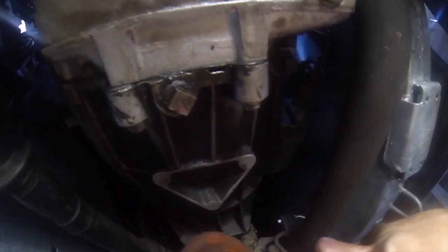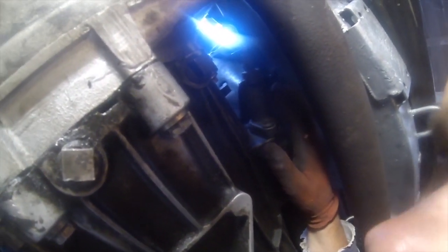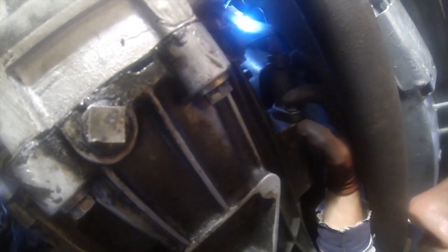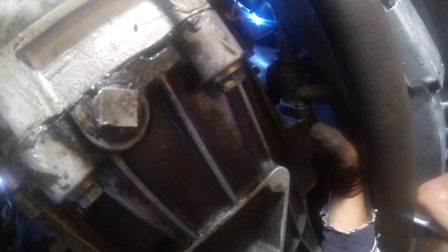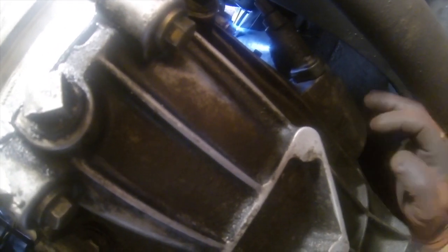Right, now under the vehicle, this obviously is the bell housing at the back of the engine, before the gearbox. Clutch is in here. And the part we need to get to is just there. 10mm bolts, top and bottom. There's one there, one there. And then a 13mm spanner needed to get off the feed pipe. It's tight. The bleed nipple is just above, but that's irrelevant, that can stay shut, because the rod is actually connected here, in about here, with a couple of little plastic clips.